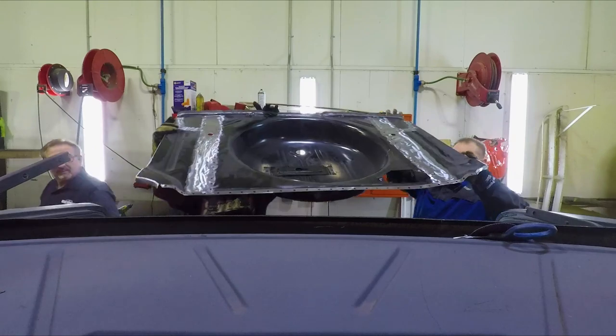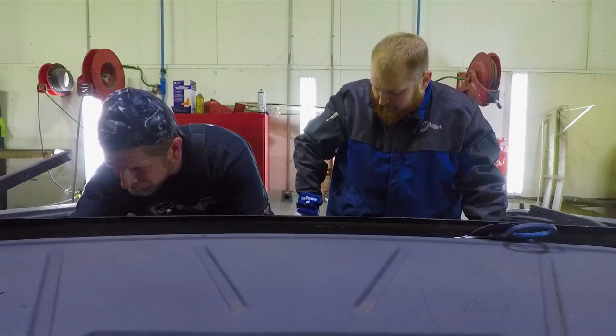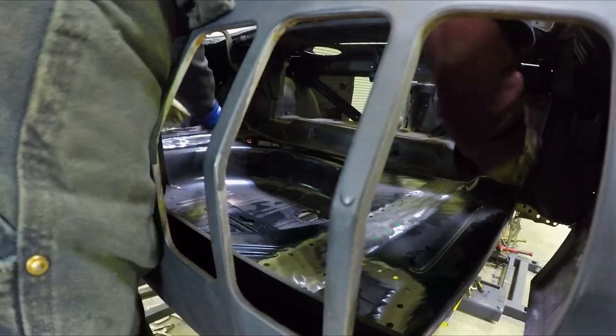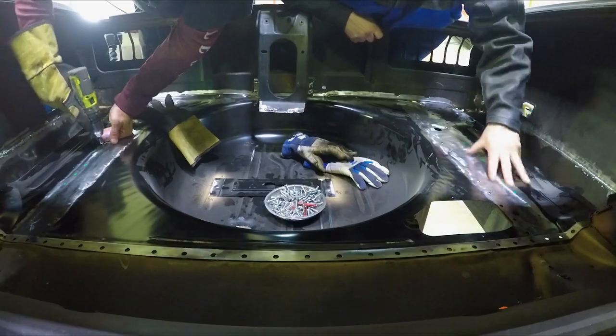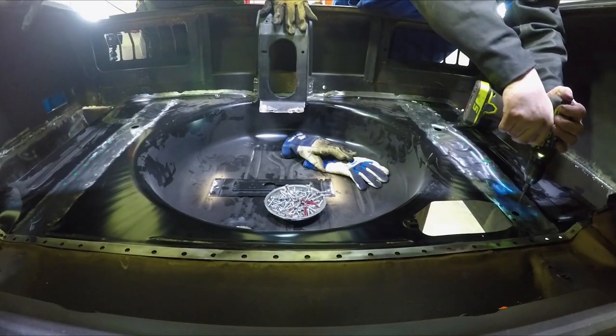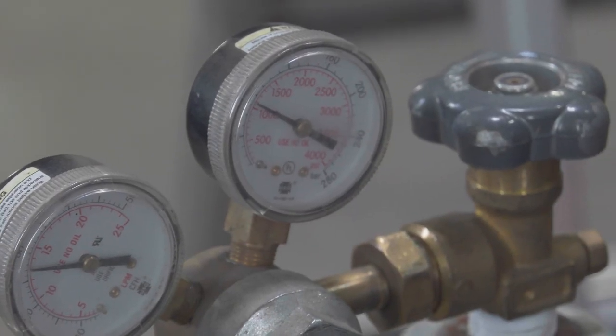One of the cool things about A-bodies versus B-bodies or C-bodies is that a lot of the parts are interchangeable. Take the trunk floor — the spare tire well that sets down, fills with water, and rusts out, but that's still the same pan that almost every A-body ever made uses. I've been buying from Auto Metal Direct for probably as long as they've been in business. Over the years they've spent the most time, dedication, and research and development on their parts than any other company when it comes to this replacement sheet metal. I'm very confident that even if something isn't 100% perfect OEM, it's so close that with just a little craftsmanship you can make it work. Same gauge, same metal — they stretch and straighten exactly like the OE parts.